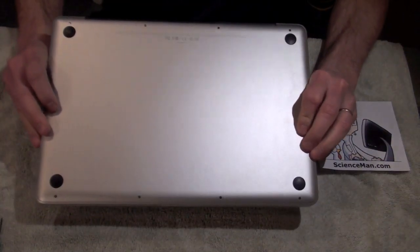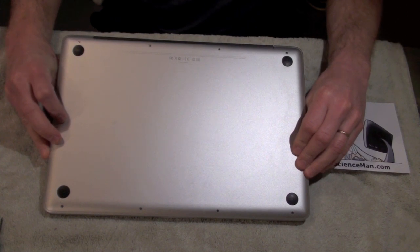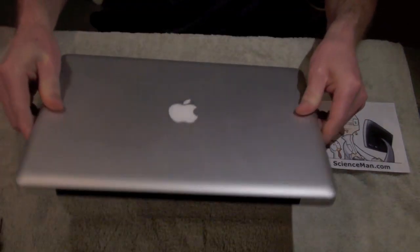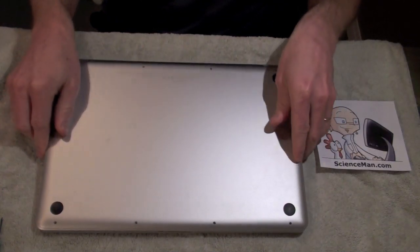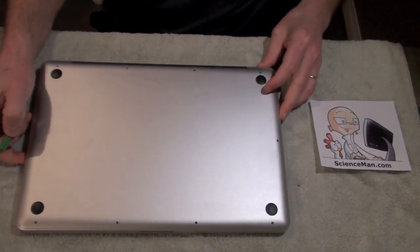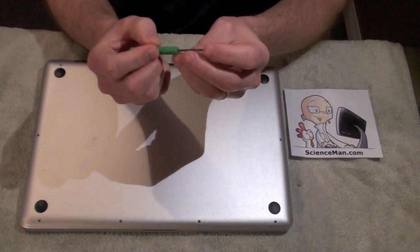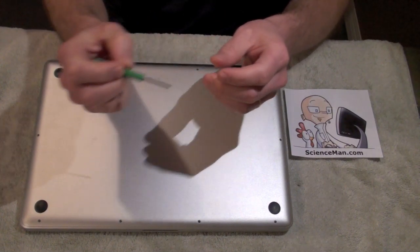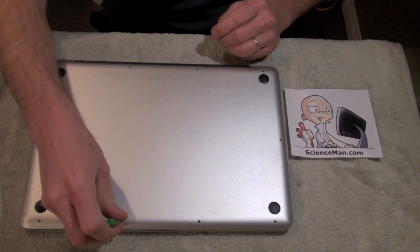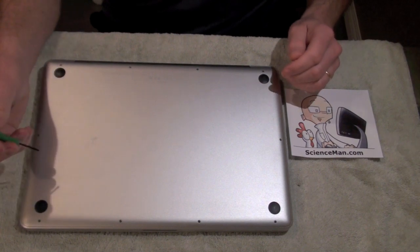You can tell these pretty easily because they have no external battery compartment. So if you want to get in to the battery or hard drive, you're going to have to take off the bottom. What you'll need is a number zero Phillips screwdriver — very small — and you want to get one with a fairly rounded tip that will fit into these screws on the bottom most easily. There are ten screws, so I'm going to remove those right now.